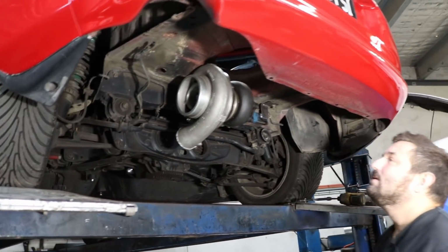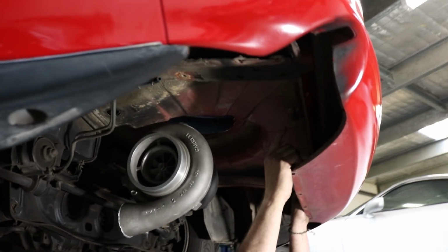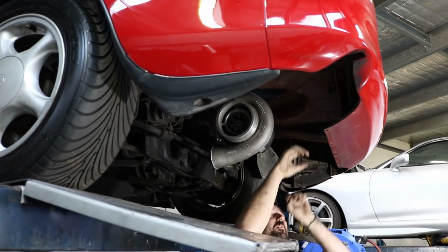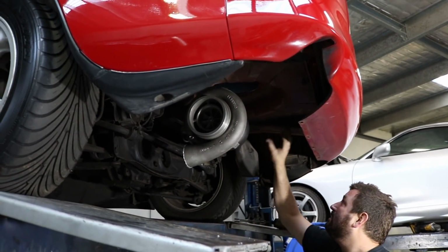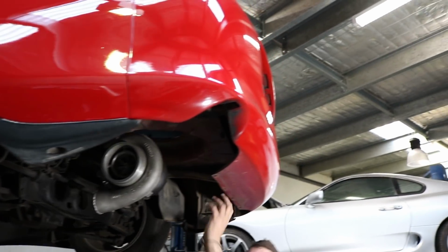So what's the plan with the muffler? Show the peoples. This back piece here, I've got to make a bit to hold this down where it originally was on the fuel tank. And then a Hurricane 4-inch muffler should fit in that area. It'll be tight. And we'll just do a 180 through here, 4-inch. And then out. And then back out through here.